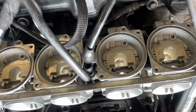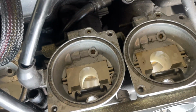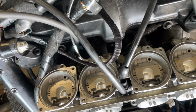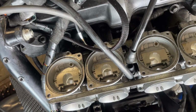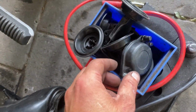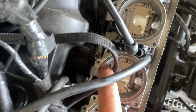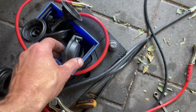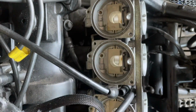But once I release it, uno, dos, still, as you can see, it's not closing all the way. That's what's happening. I tried putting some oil, kind of, but it's not working. So this spring should actually be stronger. I'm going to look for a stronger one and try again. Before I can try to start the bike again, let's see what it is. Here they go, rubbers. Three of them are okay, but this one isn't, and the rubbers are not filling the gap between this one and this cap, so they are not proper. I'm going to change them too.